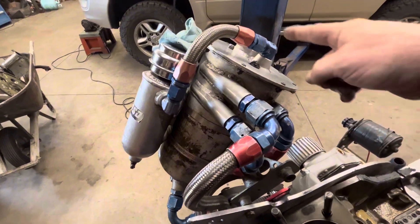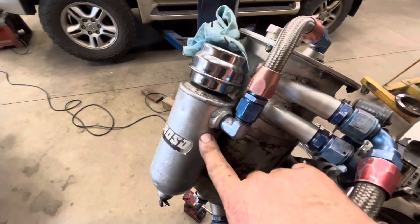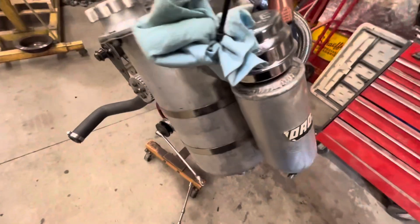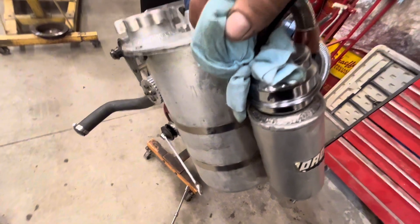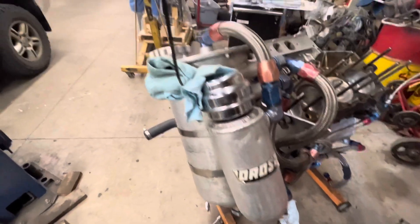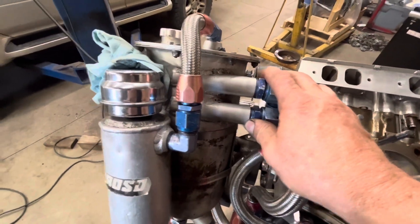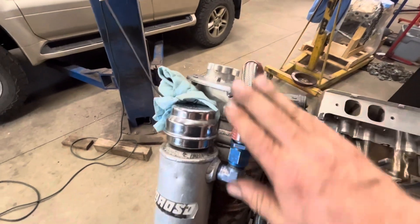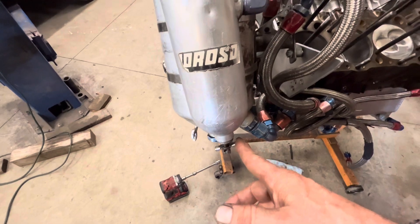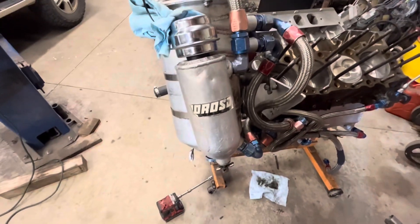Because there's so much air being pumped into this tank, you've got to have some way to vent that air — that's what this vent is for. The air goes into this little guy we call a puke tank. It has a vent on it and I just have a rag and a zip tie because it does sweat a little bit of oil and makes a mess. Oil coming in with air — you've got to vent the air out, and yes, some oil does end up in this tank. This is the drain so you can just drain the oil off. I check it every run.